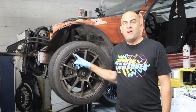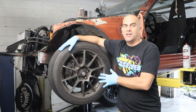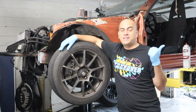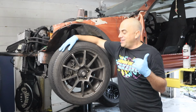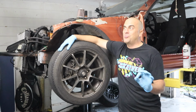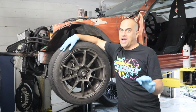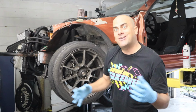As you guys know, I have my very old Sparco rims on these. These are 5x114. In the rear, they're 16x8. In the front, they're 17x7. Now, most of you know, I've been running with just three lug bolts, because I just didn't have the right ones at the time. They're on other cars. So what we're going to be doing today is making the car a lot safer and testing some stuff out.